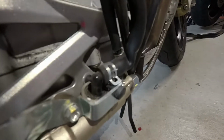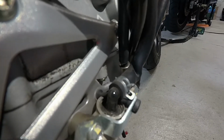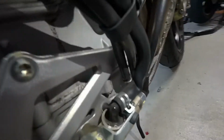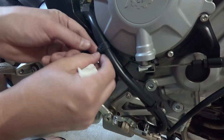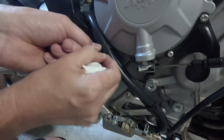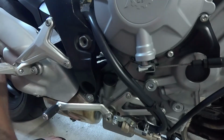So yeah, first thing, guys, I'm going to see if I can unkink that hose, maybe by just rerouting it a little bit differently, maybe giving it some more length. I don't really know, but I can tell you right now, that's a kink in a brake line hose, that's not supposed to be like that. First things first, it looks like MV Agusta uses some little rubber straps around these lines, which is actually quite smart because rubber on rubber tends to not move. So it's pretty cool. I'm going to undo the straps.